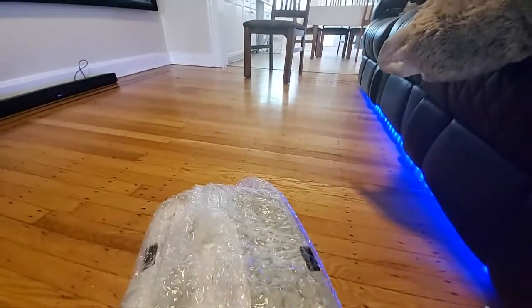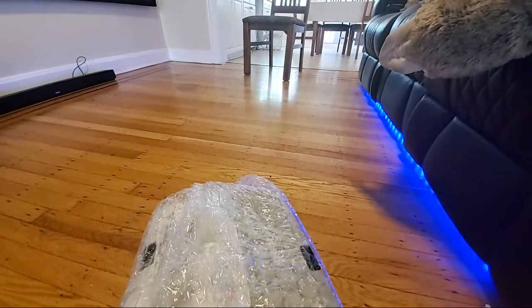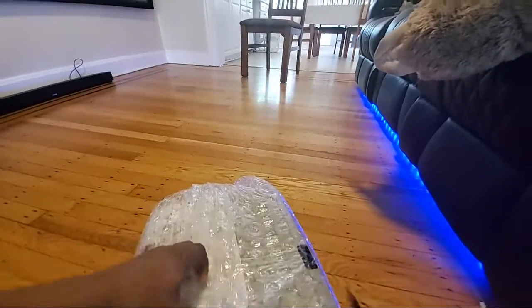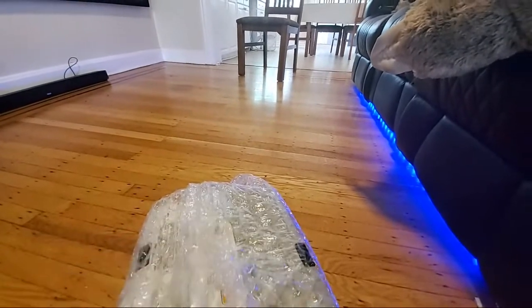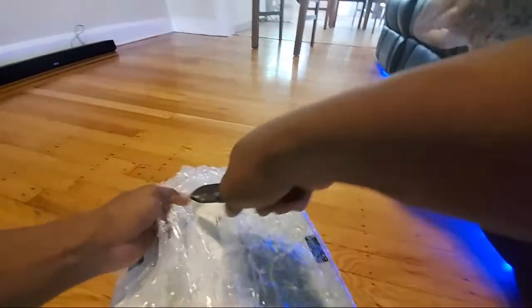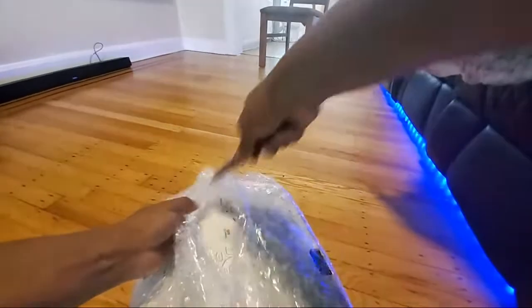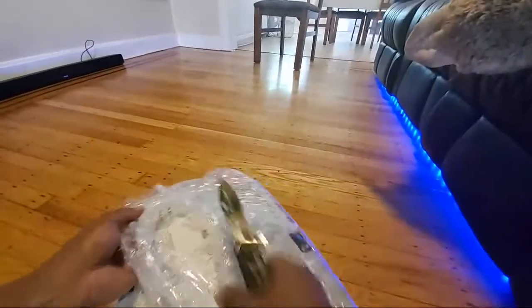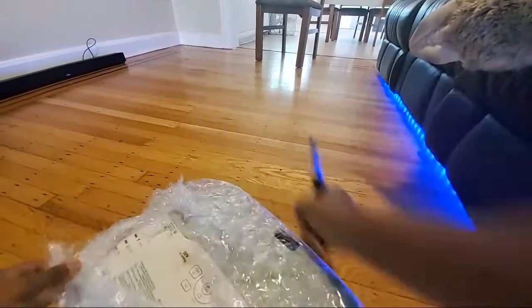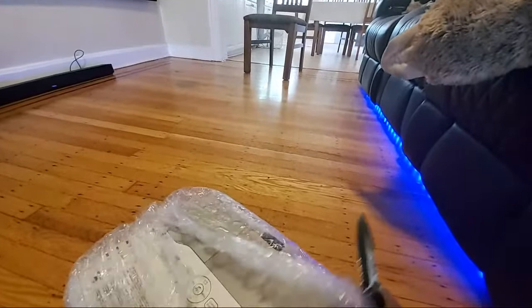The only thing you can do on an ultra short throw projector is just prove that the image is going to pop up without it going dark. A lot of these screens out here use a reflective material, and they don't work well with ultra short throw and short throw projectors. They become really, really dark. That's why they have special screens set up for these particular projectors.